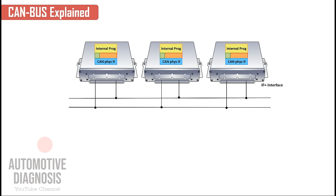All control units are connected in parallel to the CAN bus. CAN bus is a multi-master network — if something happens to one control unit, the CAN bus still works. Every control unit on a CAN bus can send and receive information individually. There is no external physical CAN controller unit you can point to — the CAN controller is built inside every control unit connected to the CAN bus.